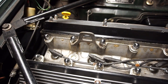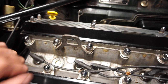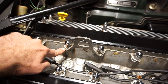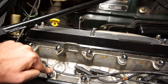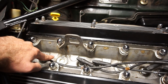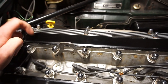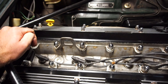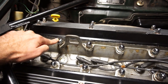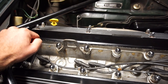It doesn't really do it when the engine's hot - it mostly happens when it's cooling down. The only way to do anything about it is to loosen this nut, and there's probably some debris stuck in between here - these go through the cooling galleries. But I'm not going to do that because the risk of the stud coming off in the bottom of the block is quite high, and if that happens it means removing the core plug and the exhaust, cleaning out the threads again - everything I've done before when I had the head off.